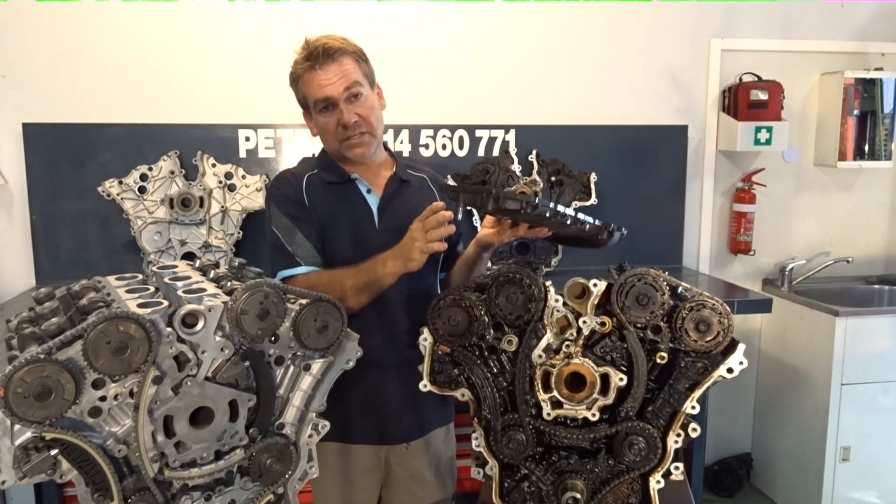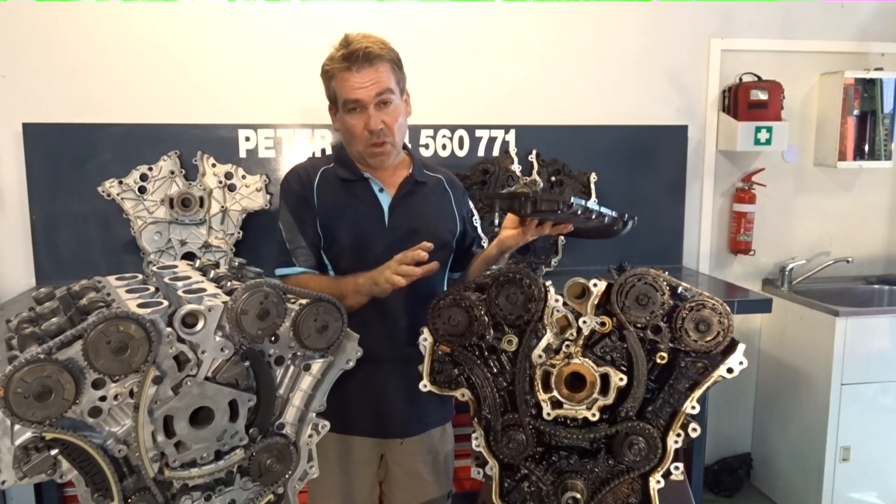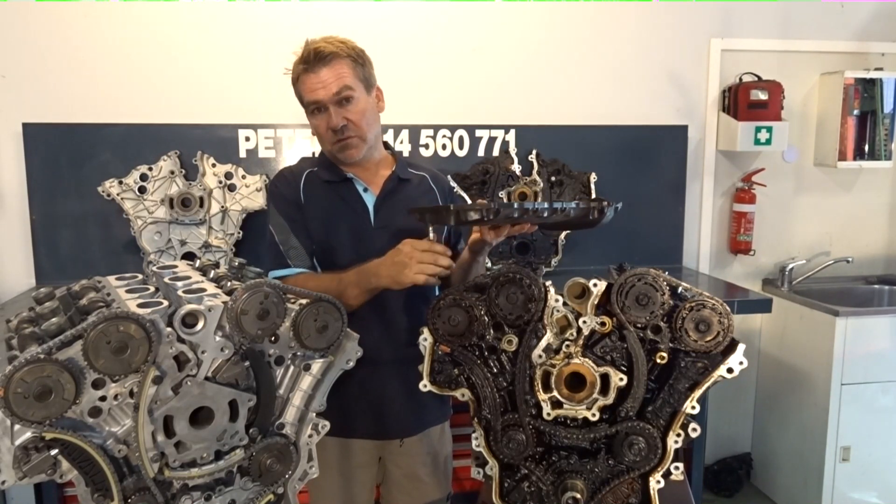At least push a piece of wire through and make sure that valve is clear. That will keep your breathing system fully operating as it should, and stop the sludge from building up and shortening the life of the engine.